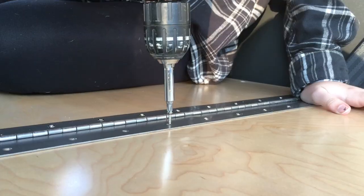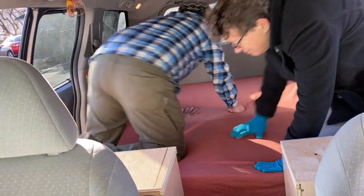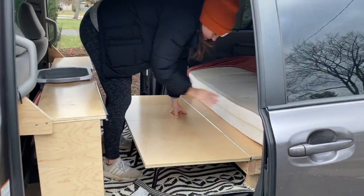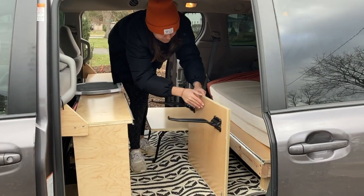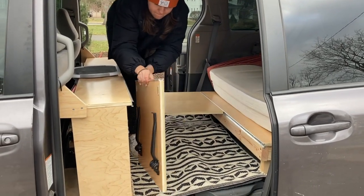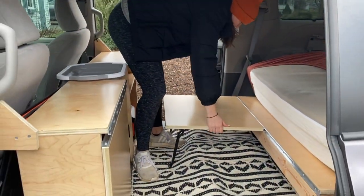There's a big piano hinge that we use to connect different pieces of the bed top together. We wanted to fit a full-size mattress so that two people could comfortably sleep during weekend or week-long trips. It's a tri-fold mattress — we'll give the links below for where we got it. We built extenders so you can shift from bed mode to couch mode, and it all relied on finding these very nice collapsible 10-inch iron pin plastic feet. We have cabinets — that's our kitchen area — and those extenders also become the cabinet doors and hook on with magnets.